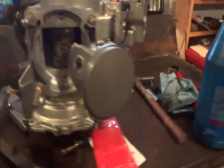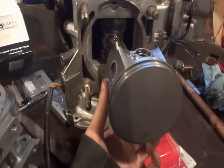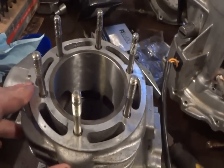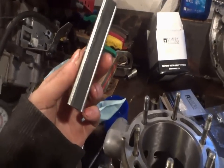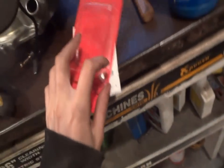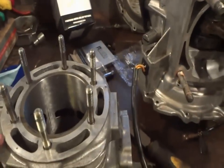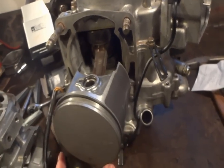Here's what I've gotten done within the past hour or so. I got the piston, the wrist pin, and all the clips on. Looking pretty good. Pulling the cylinder — it's looking pretty damn nice right now. I first used a medium grit just to get the old stuff off, and then I went to a finer. I had to run down to AutoZone to get a replacement one because I didn't have the fine. I'm just about ready to install the cylinder — the jug — onto the case. Looking pretty good, everything seems to be going smooth so far.